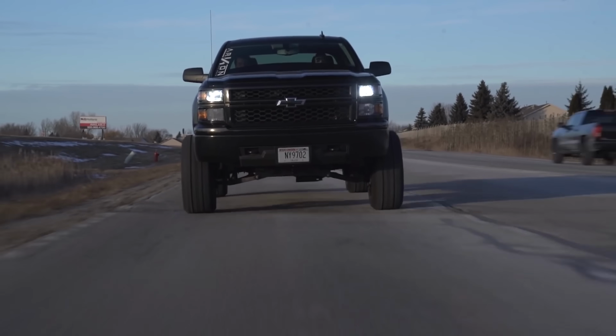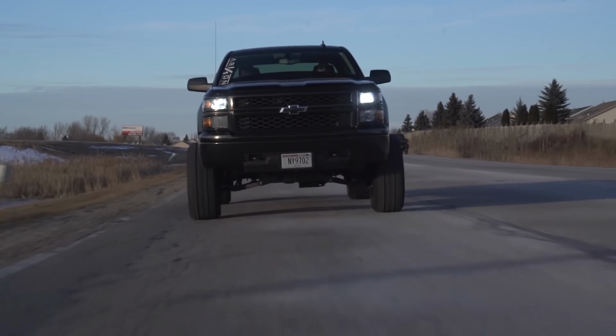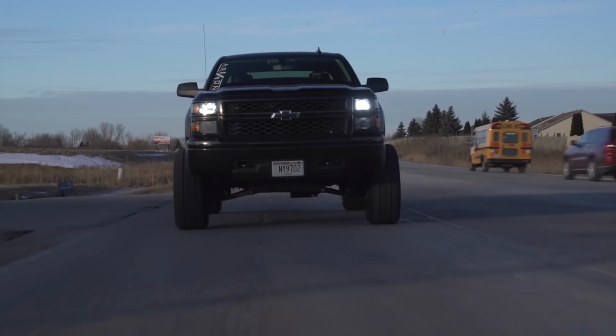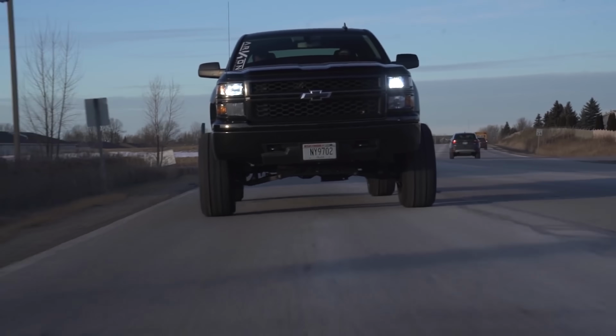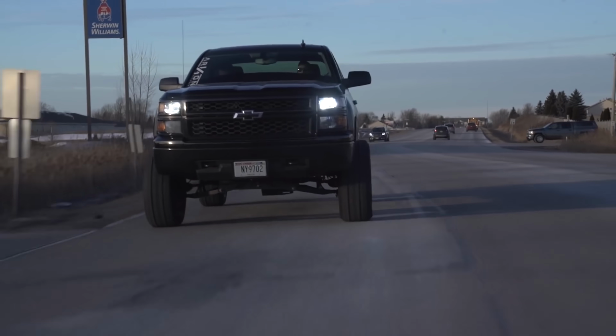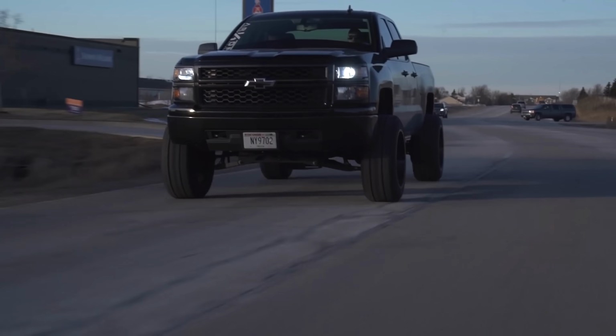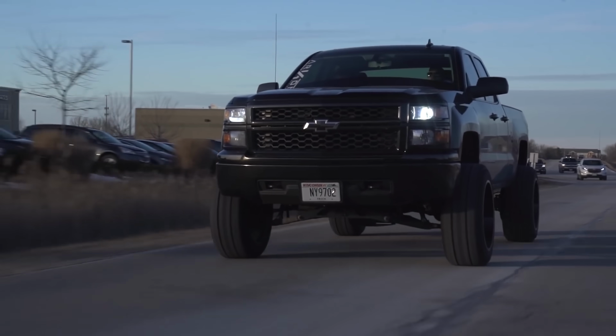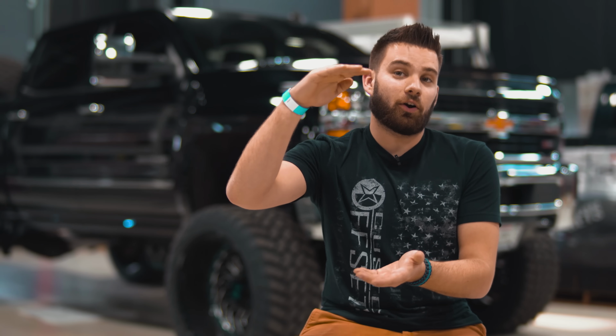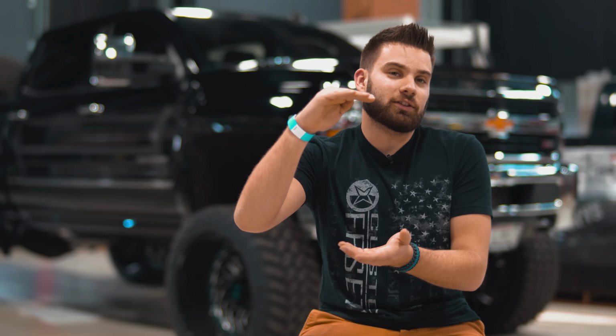the truck compresses the spring, say 5 inches, and then overall it would lift your truck 2 inches, that means that you could go in and add 1 inch of preload to the spring by turning the adjusters, which effectively will slightly increase the spring rate so that when the weight of the vehicle, again, sits onto that spring, it won't compress it as far. It only compresses it 4 inches, so therefore you've now netted 3 inches of lift compared to the previous 2.